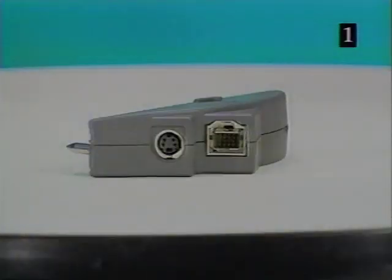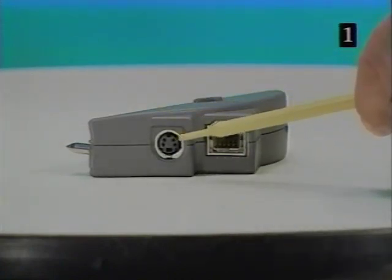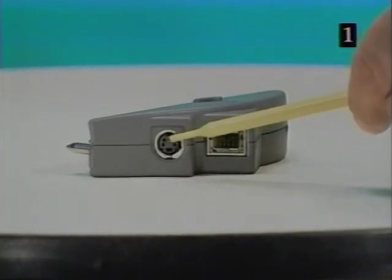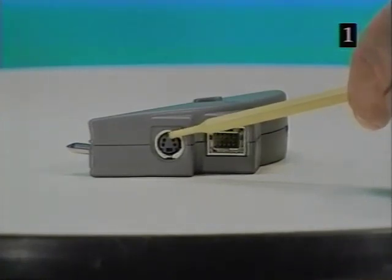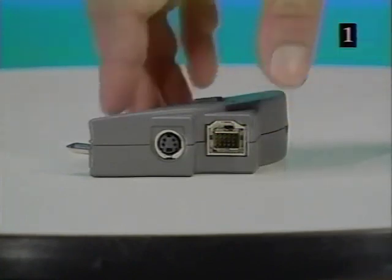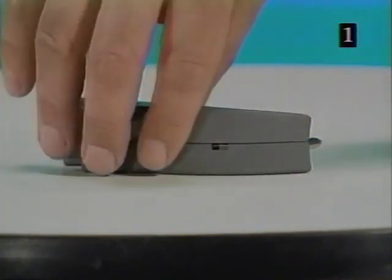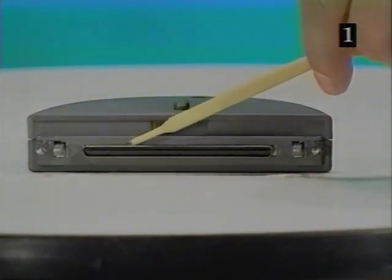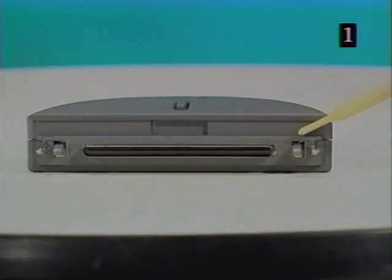The floppy adapter is an optional accessory for PowerBook Duos. It has 2 ports and 1 connector, a single ADB port using the standard Macintosh Mini DIN 4 connector that can connect an optional low-power ADB input device, such as a mouse, an HDI 20 or high-density interface 20-pin external floppy drive port. The floppy adapter also has a security slot. The floppy adapter connects to the PowerBook's 152-pin expansion connector.